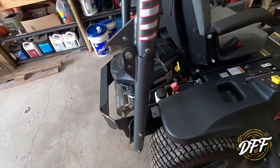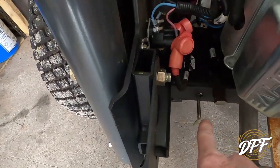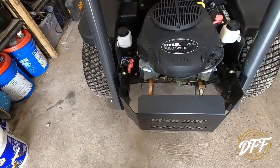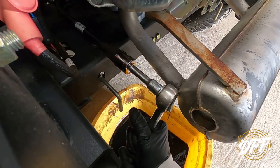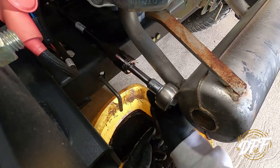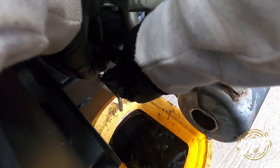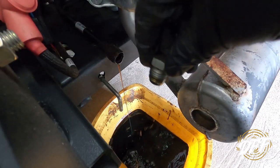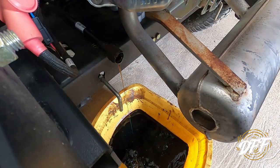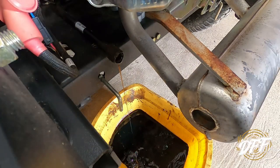I'm going to get some stuff ready and we're going to change the oil. We have a yellow Kohler filter we're going to put back on. Our drain plug is right down there so we're going to get that drained, and then we'll check the air filter. I had this running a few minutes to warm the oil up. It's a 13/16th socket, and of course the muffler right here is nice and warm. We'll try not to drop the drain plug into the bucket. Let's pull the dipstick out and see if that makes it drain any faster — nope.